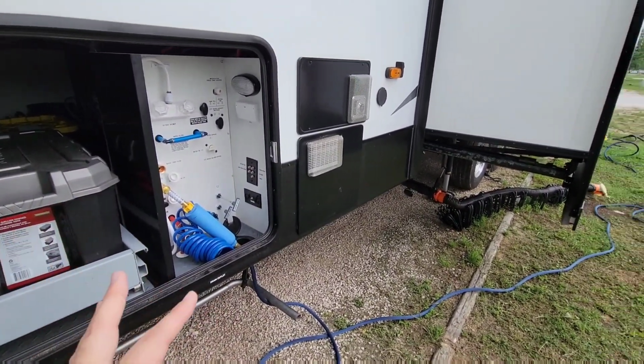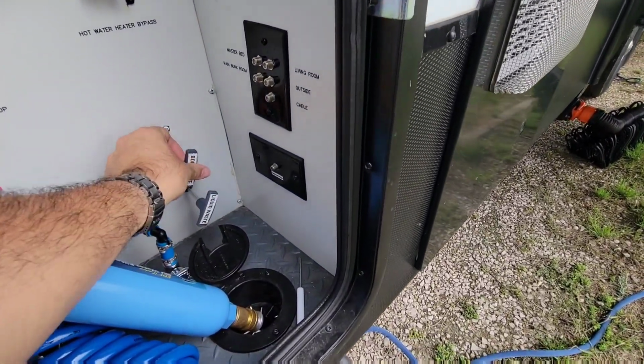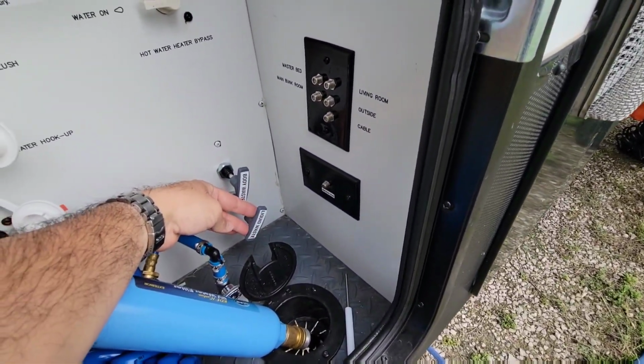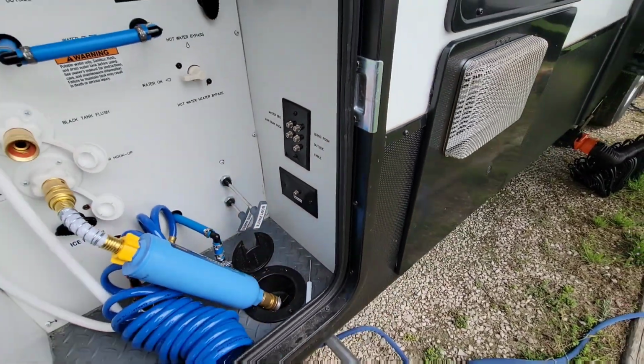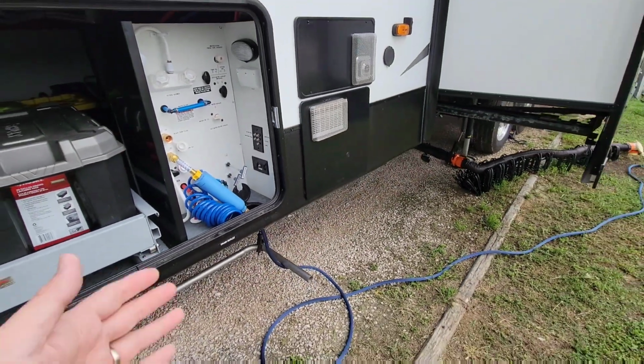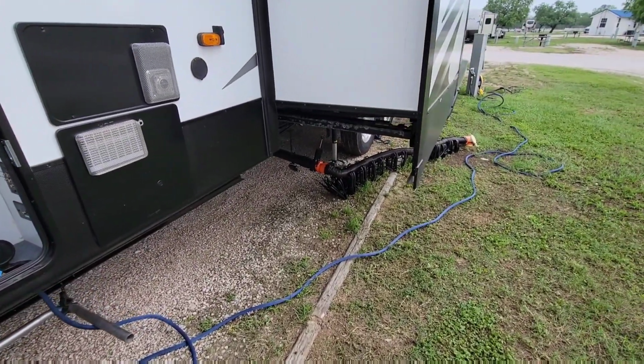I don't think that happened during the shakedown, because I had noticed before with this in, this valve stuck out a little further, and it only moves about 1.5 inches. But you can see this one moves about 3.5 to 4 inches. So that should be what the gray tank lever does as well, and it's obviously not doing that.